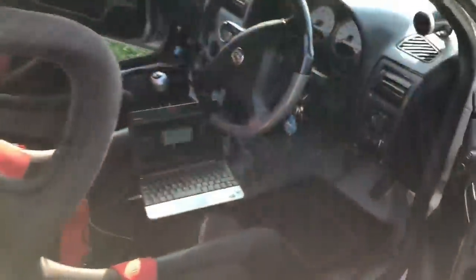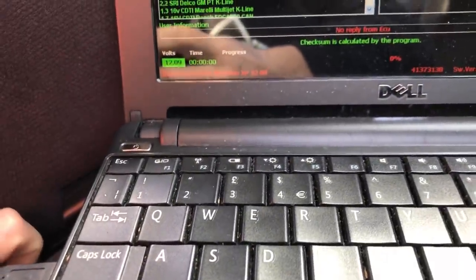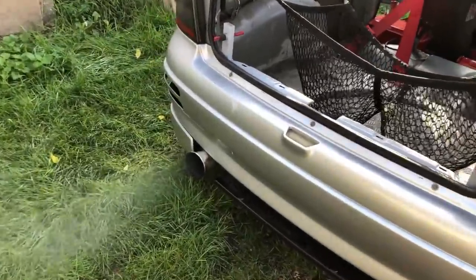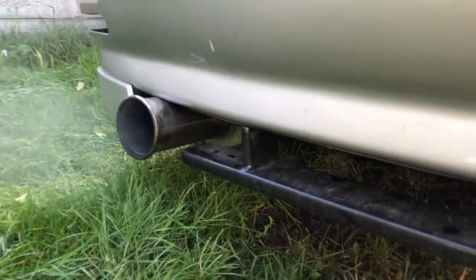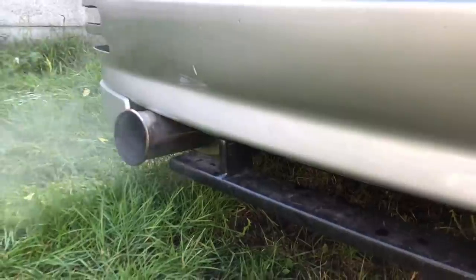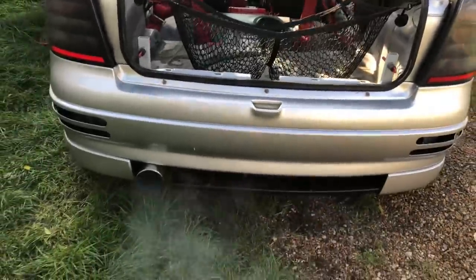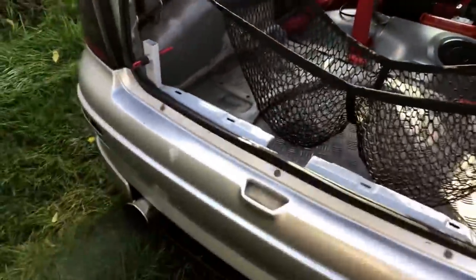We need to maintain around 12 volts for the whole time the ECU is being flashed. We've got 12.8V to the dash and 12.09V to the reader. There we go — ECU is all reflashed. Car's on cold start now. You can hear how much deeper the exhaust is now. The V-Power smell blowing in your face. I'm going to go out for a drive now, do some data logging, make sure the map is good, and check the fuel, boost, and ignition are all correct. Just letting this get off cold start.